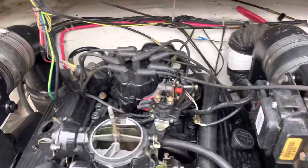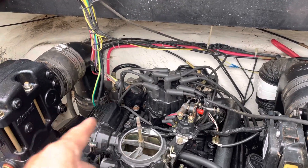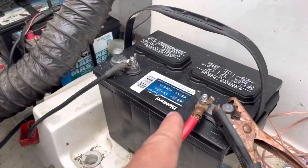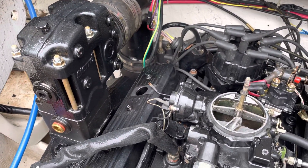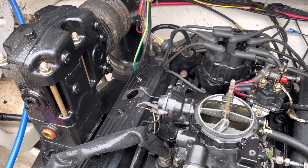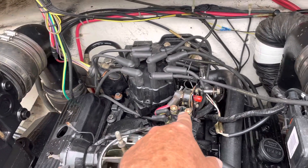So I've got the jumper wire and I put one alligator clip right here on the coil positive wire. The other alligator clip goes on the positive terminal of the jumper cables. The way the system works: you have 12 volts, your original batteries are connected, and this battery here is connected down on the starter post. That feeds the entire boat electrical system through a 15-amp fuse.